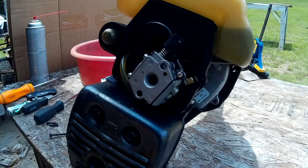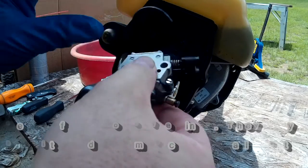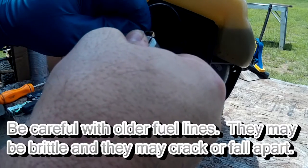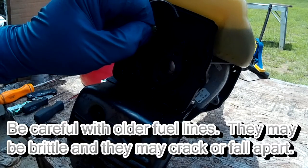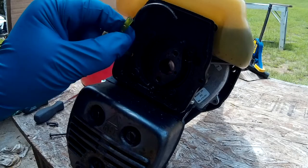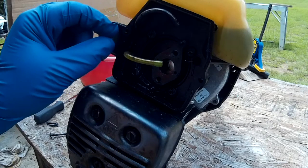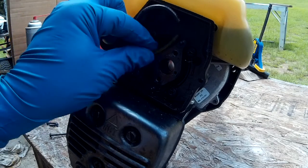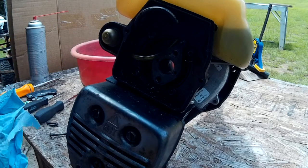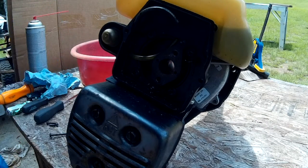I'll use this hand to hold the carburetor parts while cleaning and spraying them. That line just slid off very easily. There's a little pressure on the tank - it's a hot day - so a little tank pressure buildup. There we go - shot gas like five feet at least. I'm going to put that little hose so it's sticking up in the air to keep fuel from running out of it. And I'm basically done with the power head for right now, so I'm going to get my pan over here in front of the camera.